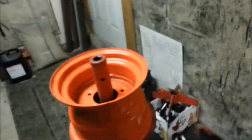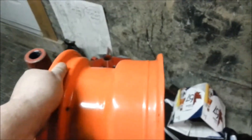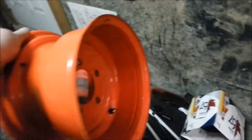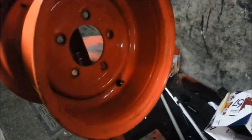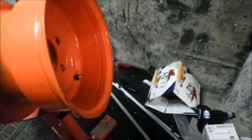Secondly, for those of us used to taking off car tires, we're used to the bead and the bead indent being on the side with the valve. But as you can see with this one, when you're breaking down your tire the bead offset is actually on the inside — so that was a little different. There's your valve side, it's the thicker side. The rim is in pretty good shape for four years old, and breaking it down wasn't too hard.